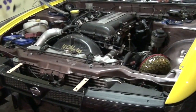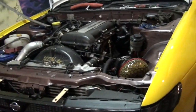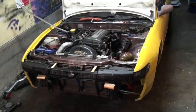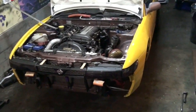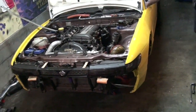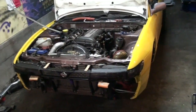Luckily, my homie Fred towed me home, and I pulled the seal and put a new one in. By the grace of, you know, whatever, the motor did not knock. We put 2 quarts in the day prior, and when I changed it the next day and drained the oil, I measured how much came out, and there was about 2 quarts. I should have checked the oil for any metal shavings or anything, but I did not. So I put it back together, it started right up, no weird knocking or anything.